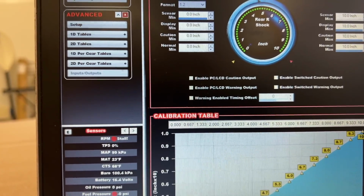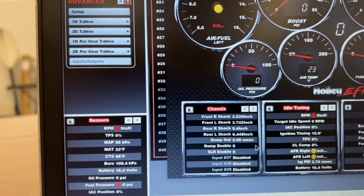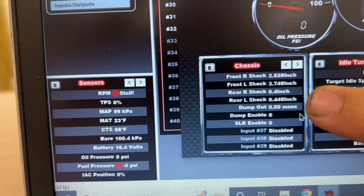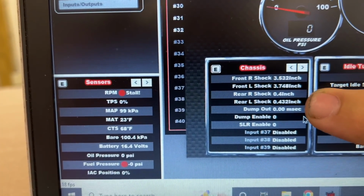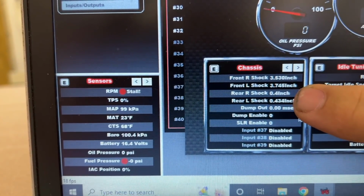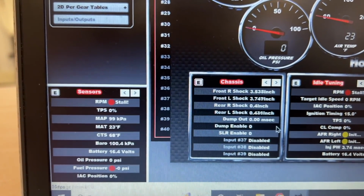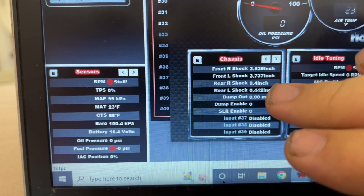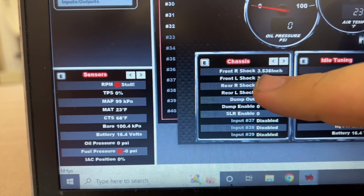So you guys saw it there, for the right rear shock, we'll go look at that. So now you can see the right rear, instead of being like it is there, just that little bit of an adjustment made it go right to there. So I'm either gonna run it in that position or the 1, 2, 3 position, because you see these just move around a lot. This car's literally just sitting right now. Once we get all our weights moved around and ride height is where it's gonna be, I'm gonna change these so that 3.5 will be our 0 point, and then it'll go either direction from there.